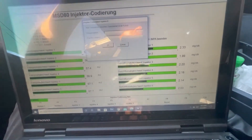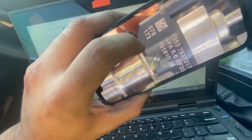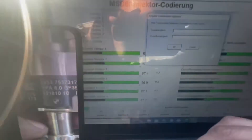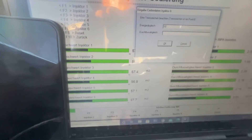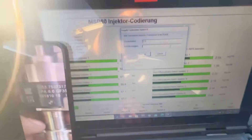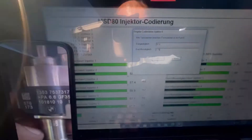Now we put in the values from the injector. The numbers are 578 and 173, but the format in INPA is slightly different from what's printed on the injector. Injector number six shows 57.7, so we enter 57.8 as the first value. For the second number it says 173, so in the INPA format that's 1.73. Enter 57.8, then 1.73, and press OK. It should update — it might look slightly off, but as long as it's close to what it says it should be fine.